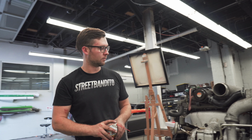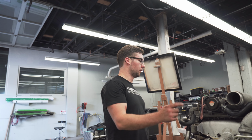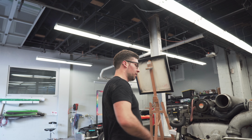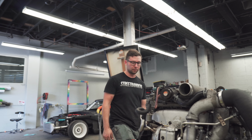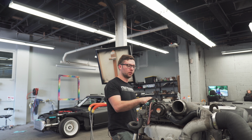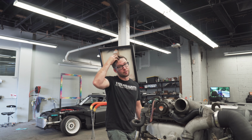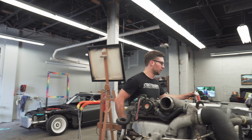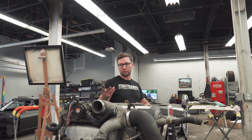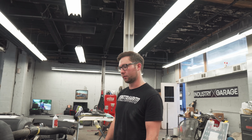I'm not. So then, what's the plan for today? I'm gonna try to pull off the exhaust manifold, pull off the turbo, and the intake manifold. I'm gonna have to pull it off anyway. So, 1JZ teardown? Yeah. I might leave the stock intake manifold, but I have to take the head off because I think I'm gonna get the head built, because the bottom end will handle like 650-ish foot-pounds of torque. The head is really the only problem, which isn't really a huge problem, but I figured if I'm in there and I have to take it off, I might as well do the head. Bottom end, not messing with that.